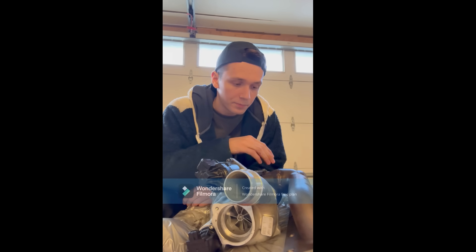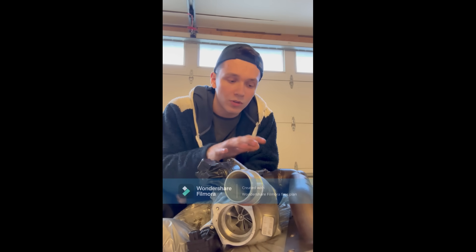Keep in mind the fueling type when talking about the boost this turbo gives me and my results with it. The tuning platform I went with was MHD and I went with a custom tune made by Motive Motorsports. Chris was the tuner working on my car while this turbo was installed. During the tuning process we went through several versions of the tune, the car became stronger with each version, and we had stable boost above 20 psi. At the complete end we had 22.5 peak psi close to the 5500 rpm mark. After the last wastegate calibration before the failure, we were super close to finishing the custom tune.